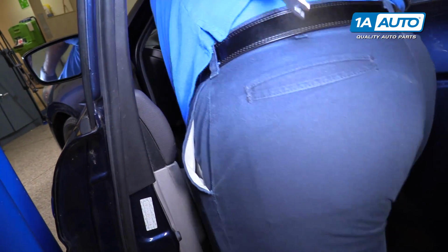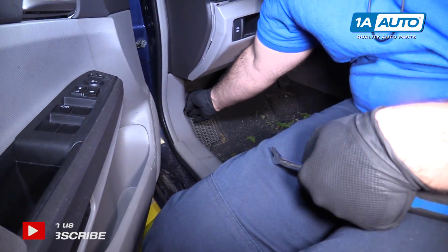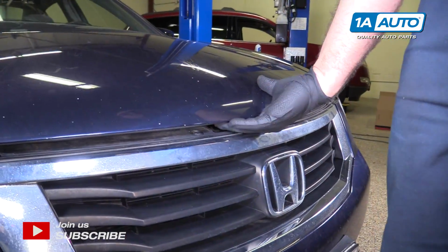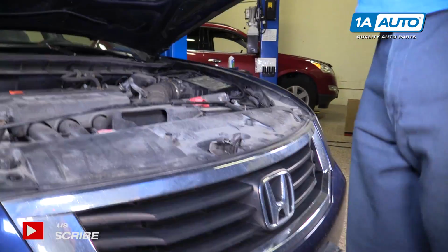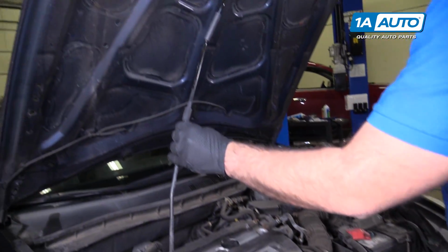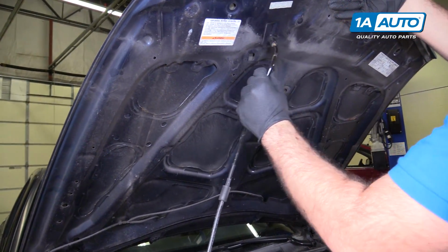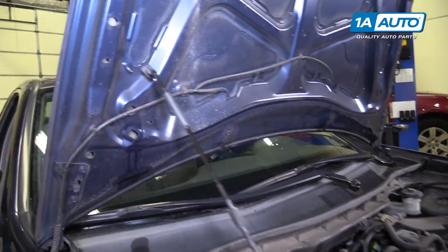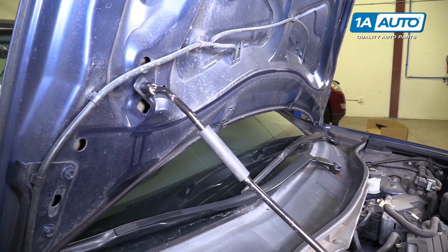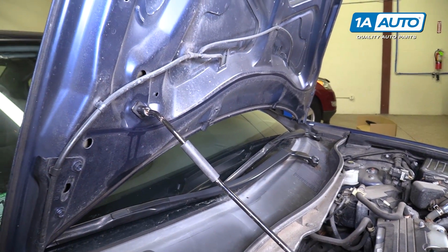Open the hood, reach down, pull the release, located far down here by your left foot where it would rest. Pull it open, release the secondary latch, just push up on it, lift it up, put this down for a second. The hood has two positions, normal position, and then if you open it further, there is a second service position here. I'll put it there for now.